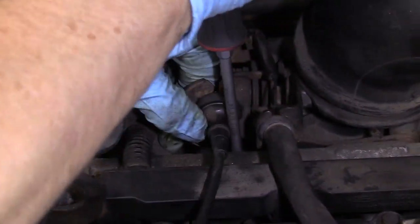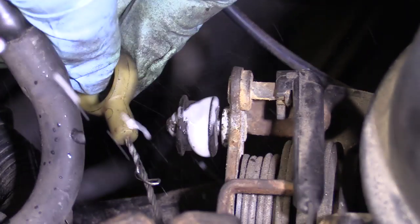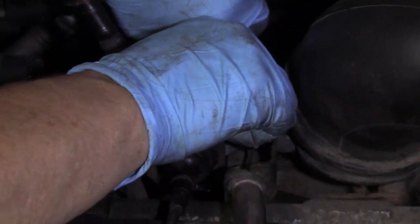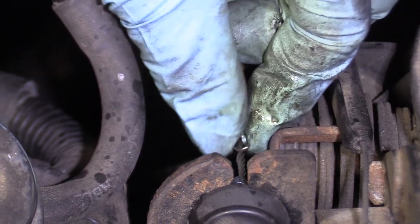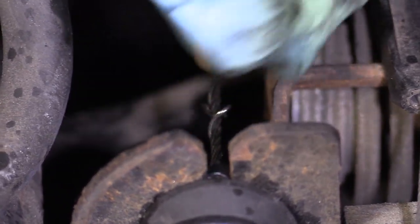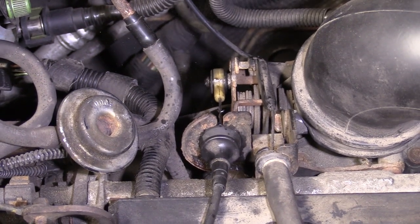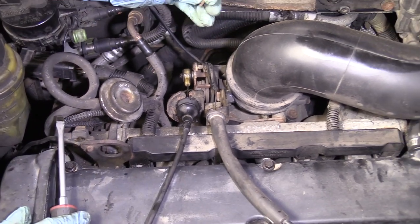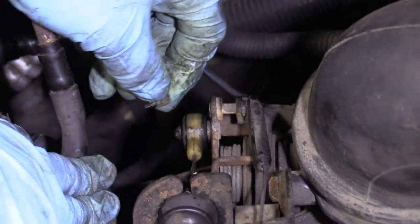There we go — perfect. Now I'm going to spray that little grommet, hopefully I can get this to slide and snap right down on. Yep, perfect. You can see this little cable burr — he doesn't need a new throttle cable yet, but that's a good sign it will need one soon. I'm just going to show you how to take one off and put it back on, and once it gets there I'll replace it. So here is our C-lock clamp — that's going to go right there.